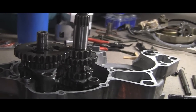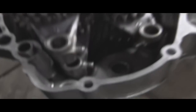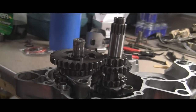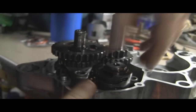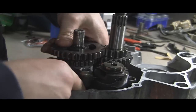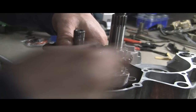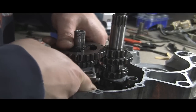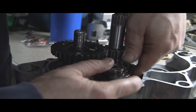You can see these are all kind of just hovering over those holes where they need to be. Next, we take our drum — this little side goes up and it slides into that other hole right there. Since the shift forks aren't attached to rods yet, they move, so we'll put the drum in here. Make sure it's in its hole, then take the shift forks and slide them into the appropriate slots. You may have to move things around a bit — slide them into the slots and slide the other side into the drum slot.